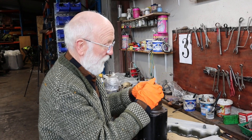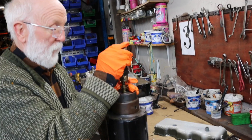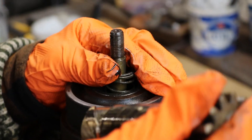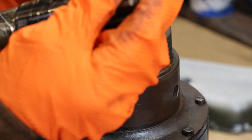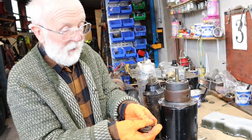Once we've done that, up comes the pinion. You'll see we've got shims and other items there — you need to be careful they don't fall out. We can then put in the new one. There's nothing wrong with this pinion; I'm only using it for illustrative purposes.